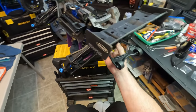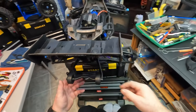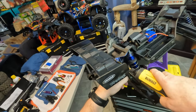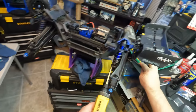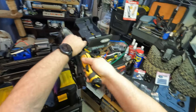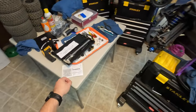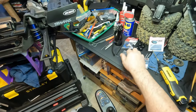Now to get to your diff cover you have to remove your wing, your arm, and the plate there to get to it — really only six screws, and I use Loctite on everything. I like to go in without taking everything off individually one at a time. Keep it nice and simple. Now if you want to get scientific about it and you have access to a little digital micrometer, just grab one of those. You can measure the thickness of each one of these spacers so you know exactly how far you're going when you decide to shim your differential.